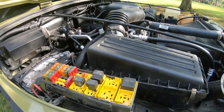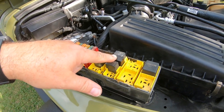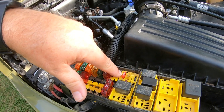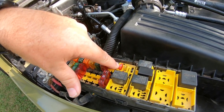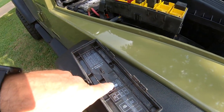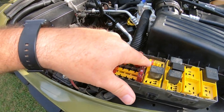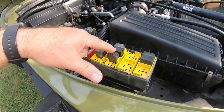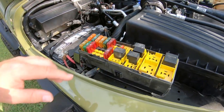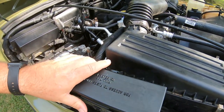All right, you got to have this relay right here. I'll leave a link in the description for that. And you got to have a fuse on the 97 TJ in F19. And in mine, it's a 10-amp fuse. And I thought everybody was saying a 20-amp fuse, but my F19 fuse right here is a 10-amp. So it has a correct fuse in it. F19, 10-amp fuse, air conditioning relay goes right here. Mine had nothing right here. It already had the fuse in the fuse block right here. Got to have those two things.